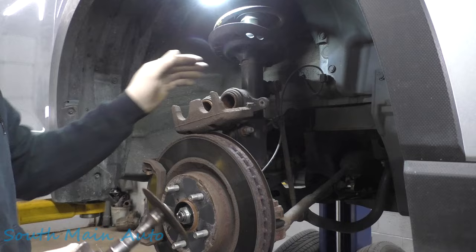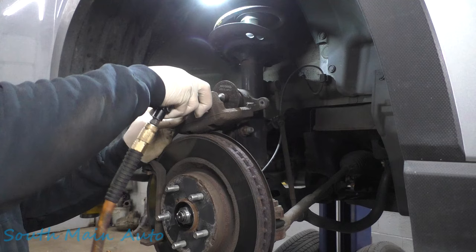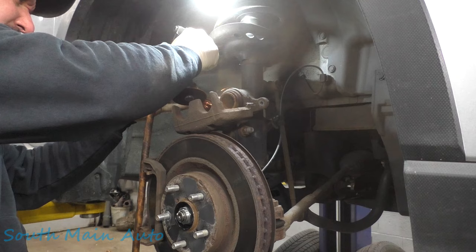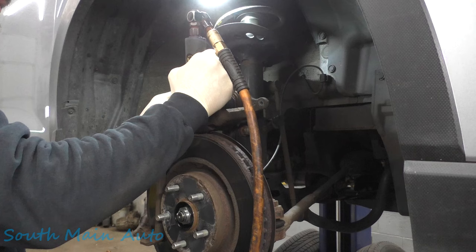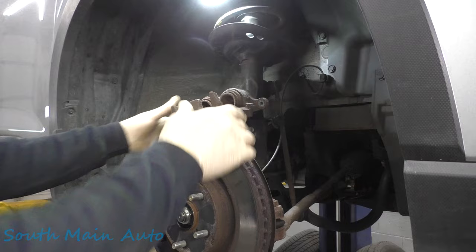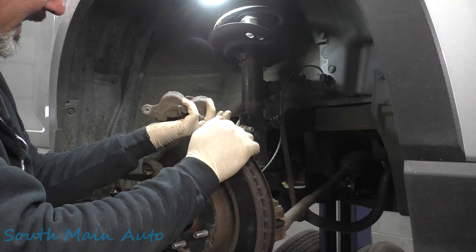Before we push the pistons in, we're going to go in with the Wheezy Wheel cleaning tool — if you guys remember that. I just like to use that to knock off some of the big chunks of rust before we go in with your standard 36 grit cookie wheel. That gets some of the big chunks off and we can get in here flat before we push them in. That looks pretty good. Always look inside the caliper where the pad sits to make sure there's not a lot of rust and junk on that — this one's not too bad.